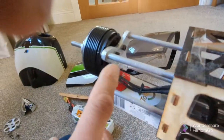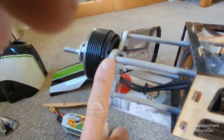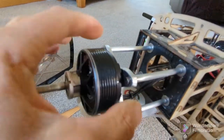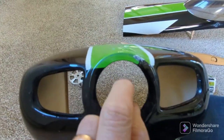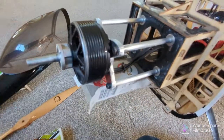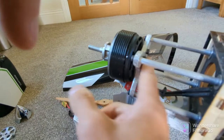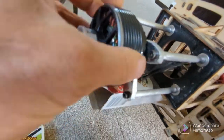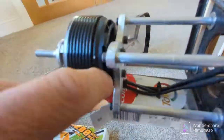And then all that is some 6mm aluminium plate. And all I did to make that was really easy. Put the cowl on, put some masking tape across while all this was off, and then put a little dot right in the middle of the masking tape, right in the centre of that. Take it off, mark it all up, easy enough. All made by hand, you don't need any special tools, and it's been absolutely fantastic. Now I can get to the bolts on the outside to take it off. I can get to these easier, with none of these silly little screws, with plenty of air that can get right through.